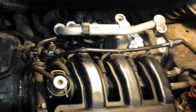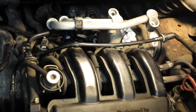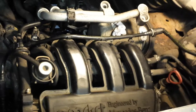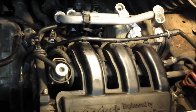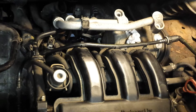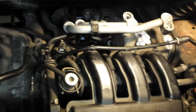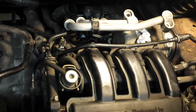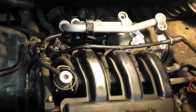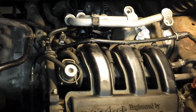My advice to make this job very easy: if you have a perfectly good working air conditioning system, take the car to an air conditioning refill place and ask them to extract all the gas. That way you're not losing any gas in the process, and once you finish with the job, take it back and ask them to refill. I've also found a kit online that allows you to do the whole job yourself quite easily — the high point and low point for the air conditioning system are just at the front when you take the front bumper part off. You just screw them on, press to let the gas in, and that's about it.